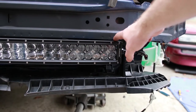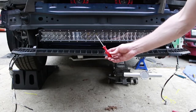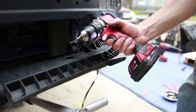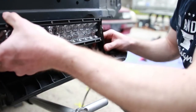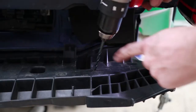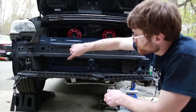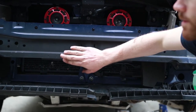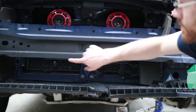Here it is with it ground down — you can see we got a little more clearance for the edge right there. Now we're going to take a pick tool and mark where to drill the holes. We'll drill these holes starting with a really small bit and work up to a final drill bit size of 15/64. There's a lip underneath the crash bar that sticks down — it's rounded and curved so it won't dig into the light bar, but just to prevent rattles, we're going to take a strip of 3M tape and apply it right to this lip.